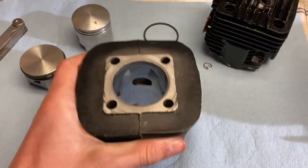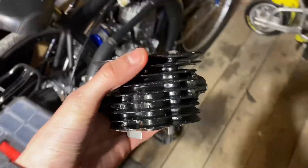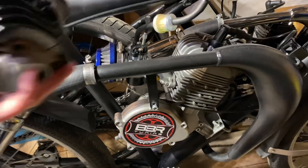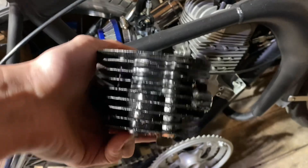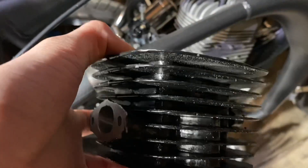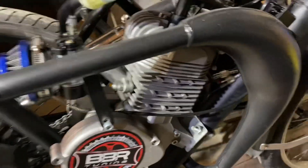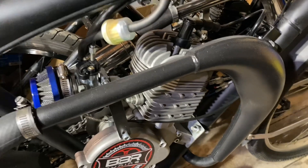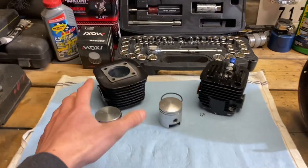Even if you're running an older style cylinder, you might say it doesn't matter if the piston is like this because it's not even close to the exhaust port. But if we compare — this is a newer kit, about $100 to $150, called a G4 cylinder. This is the older style, called a GT. You'll notice this is a GT simply because it has narrow ports inside and a very rough finish, even when painted. They usually have the 40mm intake, though I've seen ones with 32mm — those are called GTAVs. The point I'm making is that these newer cylinders have crazy wide exhaust ports, and if you put your piston in backwards you're almost guaranteed to have a ring snag. On older cylinders you may have gotten away with it, but on the newer G4s it's a no-go.